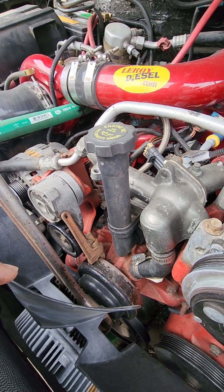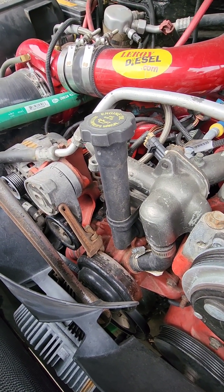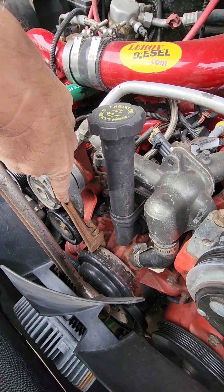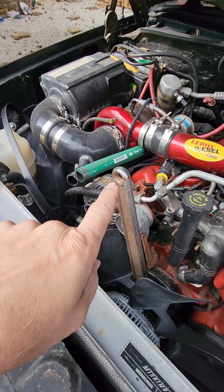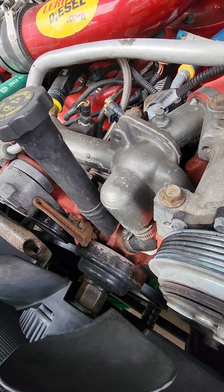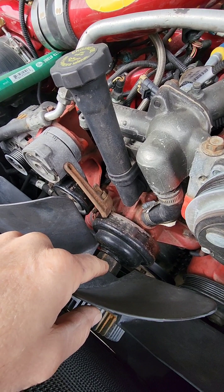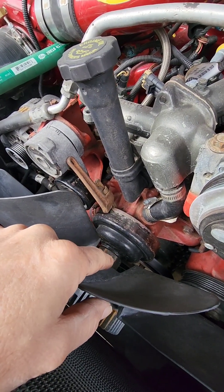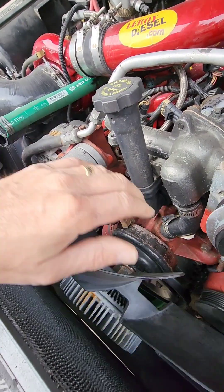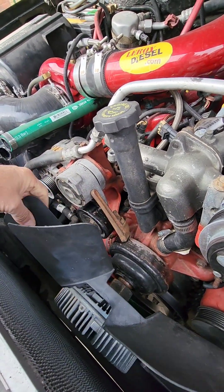You might also ask why not use the tool you can rent at AutoZone — those things aren't good. So you get the wrench on here, butt it up against something solid, get a big crescent wrench on the nut. I used anti-seize on those threads last time, and I think that helped a lot. Now it's just a matter of unthreading this clutch carefully so it doesn't damage the radiator. Make sure you protect your radiator when this falls off.